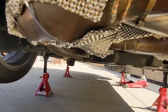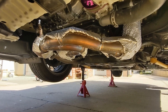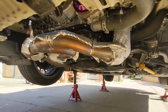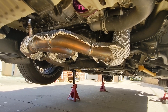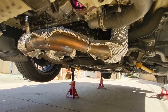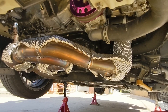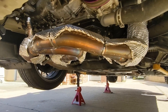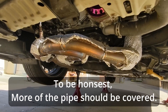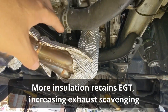Looking from underneath, I got it as good as I could. It doesn't look very nice, but this will be covered up pretty much by the factory under tray, and it allows for a little bit of breathing. People always talk about how if you wrap headers and then go splashing in the rain, that fabric gets wet and causes rust to happen. So this allows for breathing underneath, but it also adds insulation. It looks terrible, but I know it's going to help because from the top it totally blocks the timing cover and this area here.